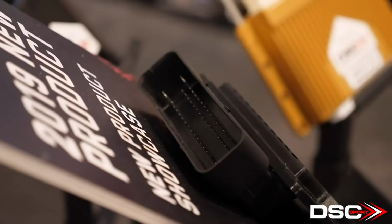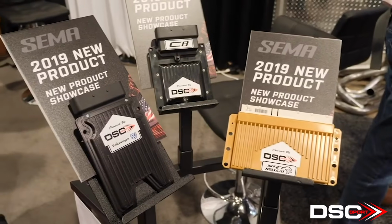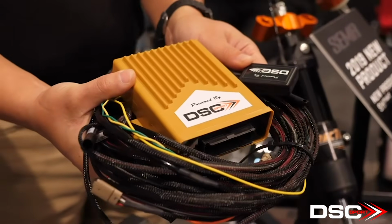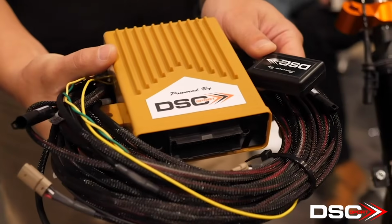As far as other sensors that are used, there are the velocity sensors. We talked about that briefly before. So if you were braking and you happen to be braking on a bumpy patch, the sensors will pick up the patch, and then we will subtract X amount of damping force to make the car a lot more compliant, so the car is not uncomfortable and it remains stable in the braking zone.